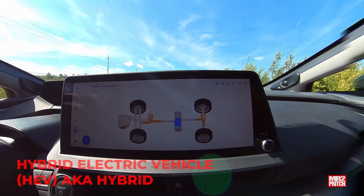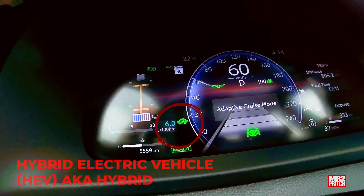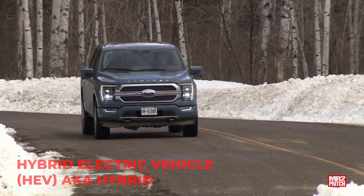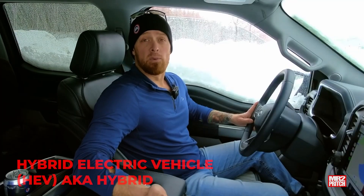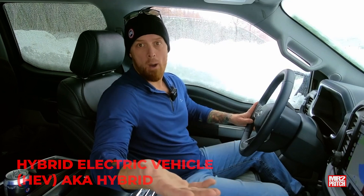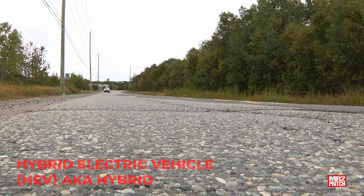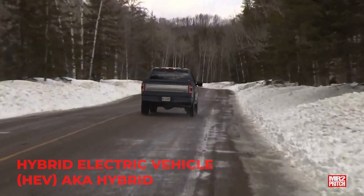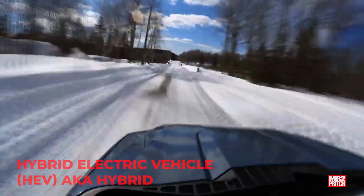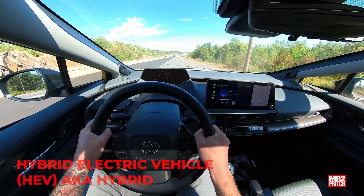These enhanced components are costlier, but they expand the benefits of hybrid driving. While a mild hybrid engine can't provide any all-electric motoring, a hybrid engine like the ones in popular Toyota hybrids, the Ford F-150 Power Boost, and the Honda Accord Hybrid can drive for short periods entirely on stored electricity using no gasoline at all. These moments of fuel-free driving add up over every tank to cut emissions and stretch your fuel dollars further, typically cutting fuel use by around a third depending on the model.